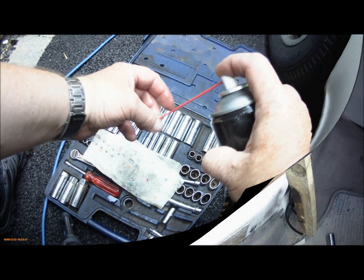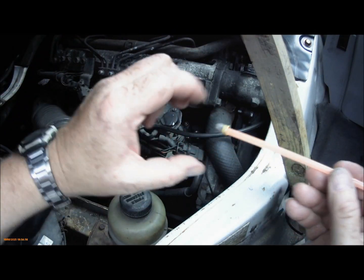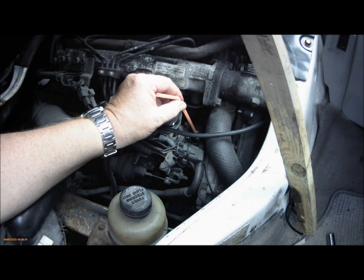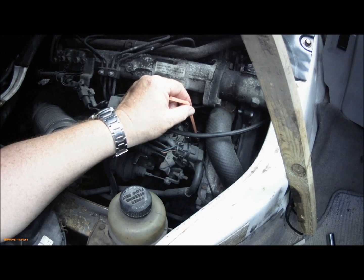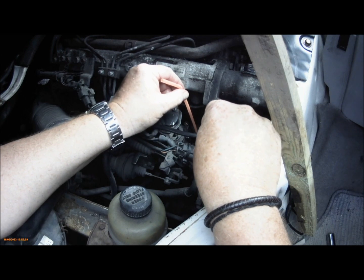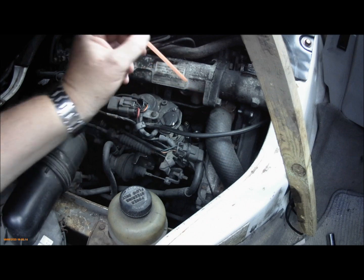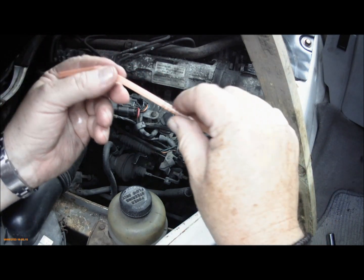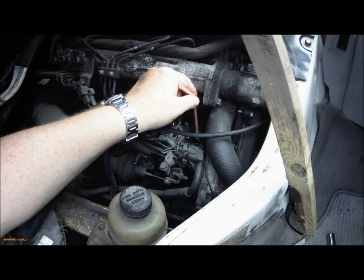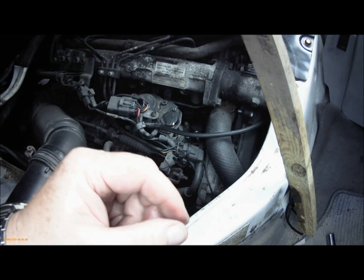Why the hell not? To reassemble, put the straw back in your Banjo filter, make sure it's seated correctly, then use the straw to put the filter into the hole. Use your metal rod just to knock your Banjo filter off the straw. Again, utilising the straw, put your spring on the straw, put the straw in the hole, drop your spring in the hole. That makes sure you don't lose your spring.